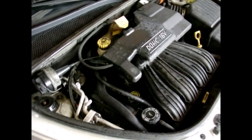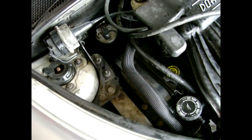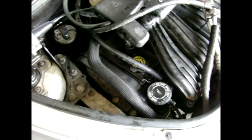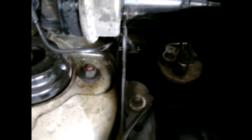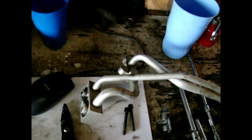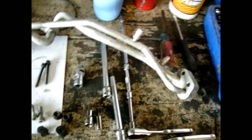Here's where I'm at now. I've gone ahead and removed the air compressor lines after I relieved the pressure. Down there is where the junction block goes to, and the lines are tied out of the way. This is the bracket that I was telling you about that connects the condenser and the evaporator.